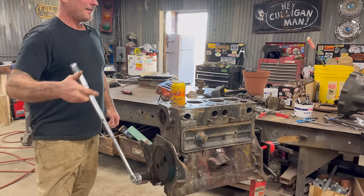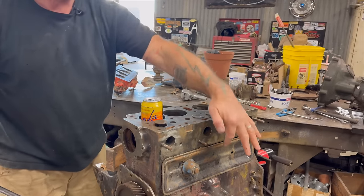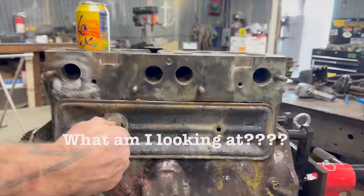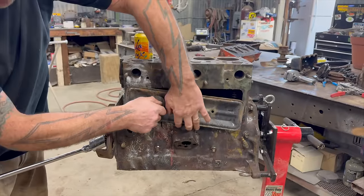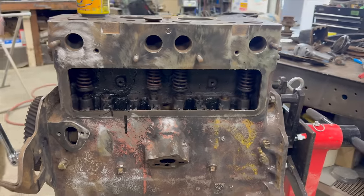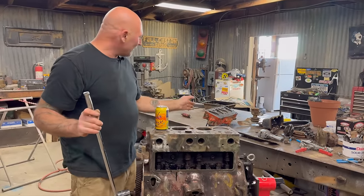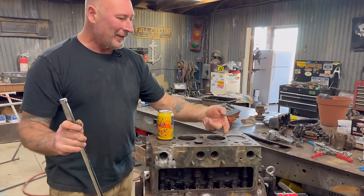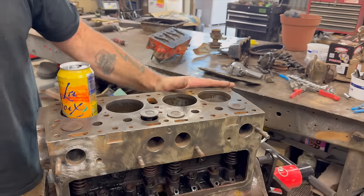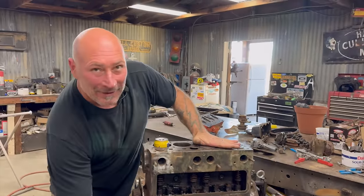Can you dig it? You were watching all that stuff in Germany with the automatics. Oh sorry, I was like, what am I looking at? Put that cover back up. Oh wow, so can you see what's going on? Can you come up with a theory as to what's happening here? It's creating pressure. It is. So you're only seeing half the action. This is the exhaust valve. As this turns, there's a push rod here, so it's pushing that valve. As it turns, this valve opens. It's pulling in — it's breathing. And then this one as it comes up — it's exhausting.